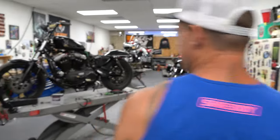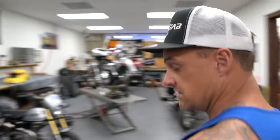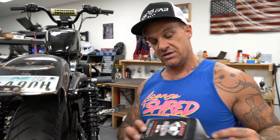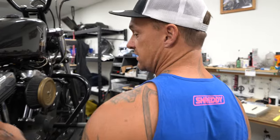60 weight, full synthetic. Out here in Arizona it's hot — it's May, almost June, and it's in the hundreds. Anything over 85 on an air-cooled motor, you should run 60 weight. Klotz Racing — they do not promote us or sponsor us, this is just a free shout out because I've been running this stuff forever. It smells good, like mineral oil. I worked for Gymnasty Customs and we ran these 155 inch Pro Stock motors that were like $23,000, and if you didn't run this oil the warranty was void. So I've been running that oil ever since. In the summer we run it, in the winter we run 20-50 because it's cold out here too.